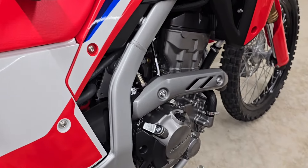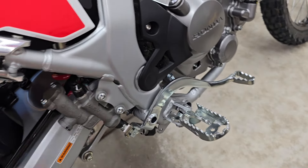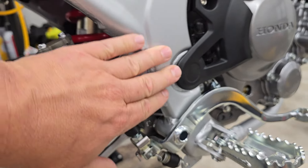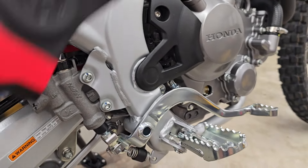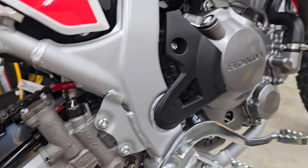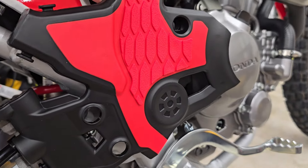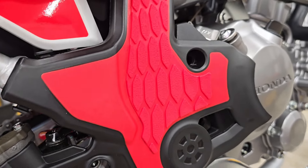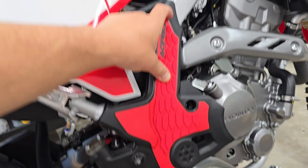People have talked about the frame paint being fairly thin on here. I can see it's holding up okay, about as well as anything else, but with boots rubbing on here, eventually it chafes through. I was hesitant to put this on at first because I didn't want to lose this cover that protects the engine and also a little brake switch behind here. But when I started to look at the new cover, it actually adds protection — you're gaining protection over your rear brake master cylinder, and it replaces this one up here. So you're gaining that back.